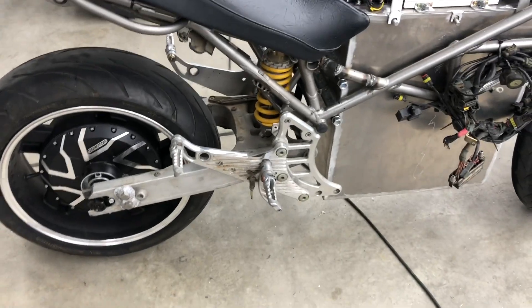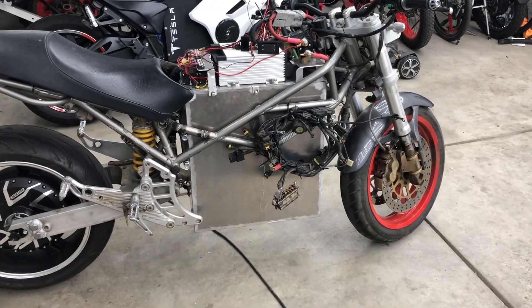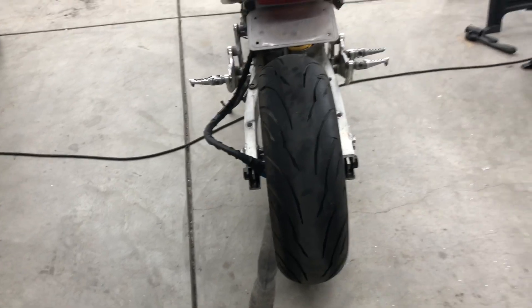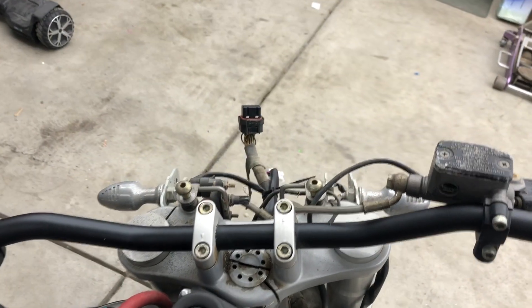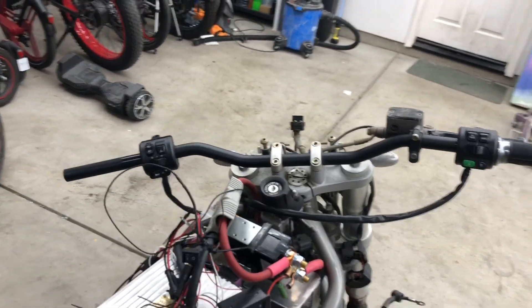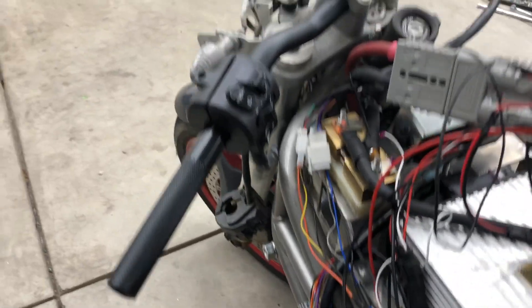Looking at the weight distribution of this bike, you're not going to get spontaneous wheelies — with the controller weight, case weight, and everything else, about 180 pounds is sitting with two-thirds of the weight to the front. However, the rear tire is fat enough that hypothetically when you're sitting on it, you're not going to get a lot of burnouts — it just puts power down. As long as we can program it to deliver as much power as possible, that's going to be a good combination. Big things still left: attach and program the CT22 module — the same module Zero Motorcycles used from 2014 onward — which needs to be programmed based on tire diameter and things like that for the correct speed conversion.